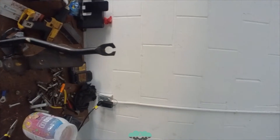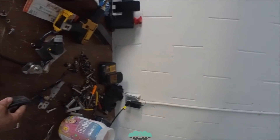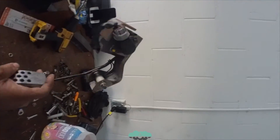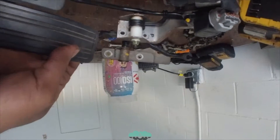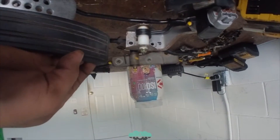To convert this over to the VQ, I need to swap the gas pedal out because the original is drive-by-cable and VQs are drive-by-wire. So I've got to take that out and put in the one I bought. Here's the one I just removed — you can see where the cable would go. This is the one from a 350Z and it's drive-by-wire. The only issue is that the mount holes are different distances apart, so I'm only going to get one screw, and I don't feel like that's going to be safe or satisfactory.